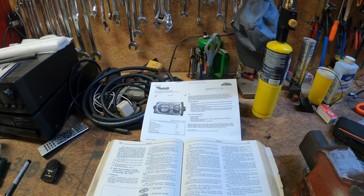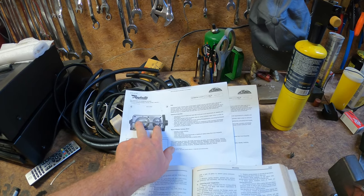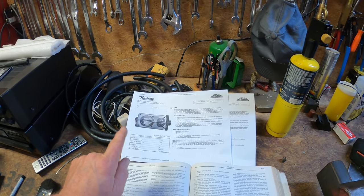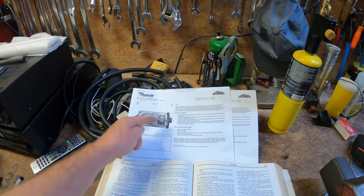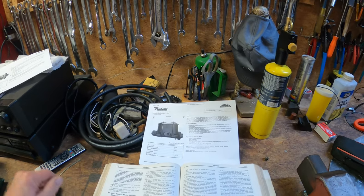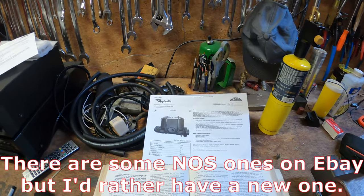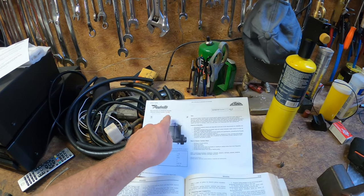How did I correct the issue? I said, forget about the car — I want to find a brake master cylinder that has the same size chambers, a half by 20 on the front, nine-sixteenths by 18 on the rear, and a shallow piston depth. Well, guess what — you can't find that. Nobody makes it, at least not that I can find. I did find this: it's a Raybestos MC36280.